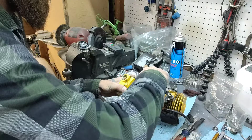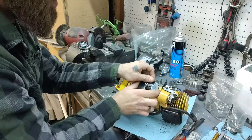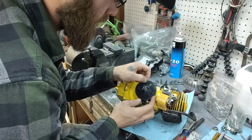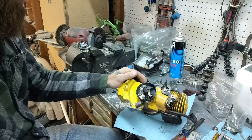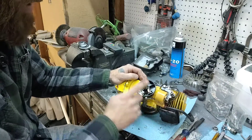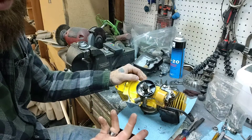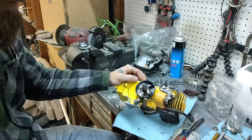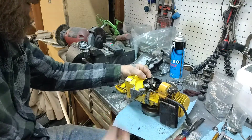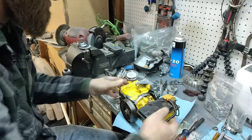We're going to get all this off, get all this bagged and tagged. This cover is actually snapped in pretty well, and that's obviously how I broke it. So we have the points in here. Now, we're not going to use these points. I'm going to keep everything here in case the electronic ignition module doesn't work, or if you don't want to use that — you can always switch back to the points. Pretty important to keep that stuff laying around. It's always good to have it all around.